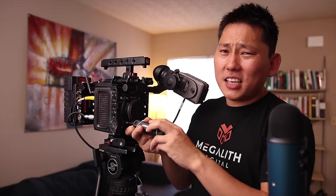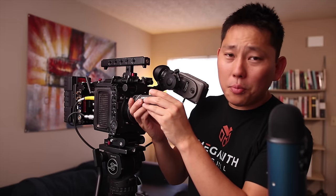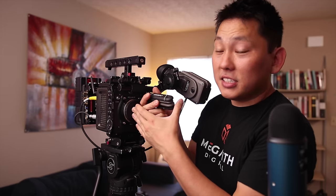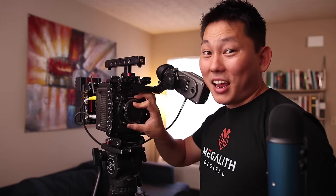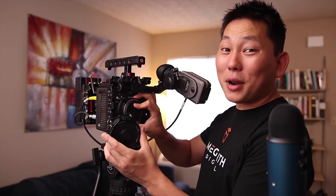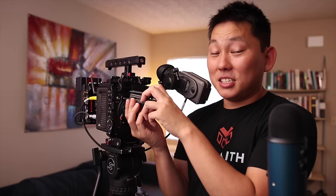What's awesome is that both of these cameras can be swapped out very easily between a PL mount and an EF mount. PL mounts are the industry standard for high-end cinema lenses, and a lot of us already have EF lenses for Canon cameras — so just pull one off your 80D or 5D and you can slap it on this camera. It's literally just a matter of switching out four screws to change the mount of the camera.